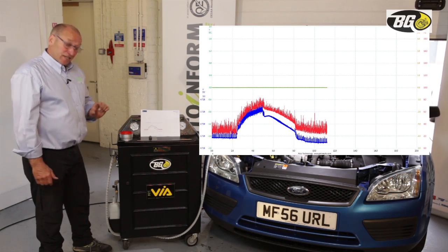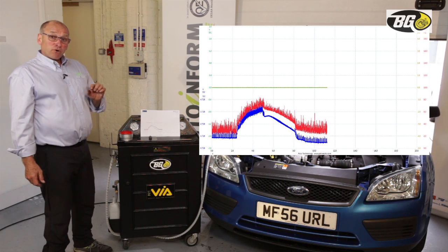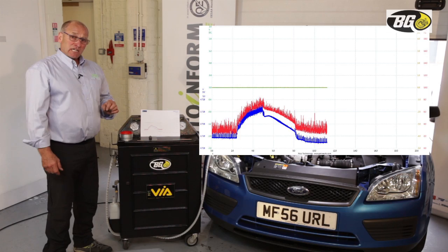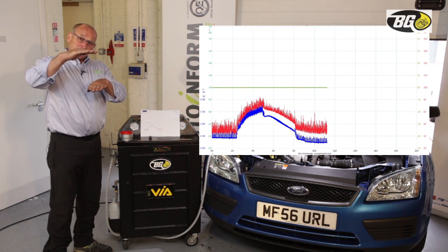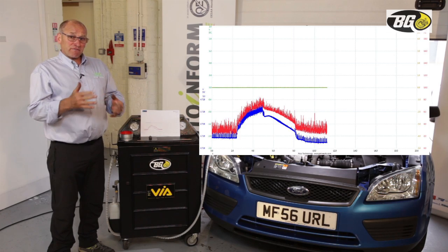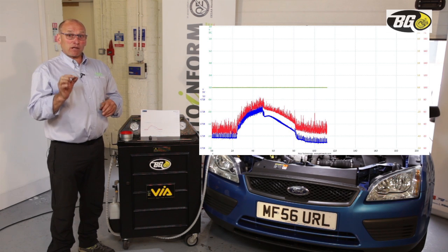The scaling on this image is 5 volts. The sensor operates from 0.5 to 4.5 volts, and we have at the peak almost 4 volts coming back from that sensor. If zero pressure represents low voltage and one bar above atmosphere represents 4.5 volts, then nearly 4 volts of value means the actual pressure in the DPF is probably around 750–800 millibar — 0.8 of an atmosphere.